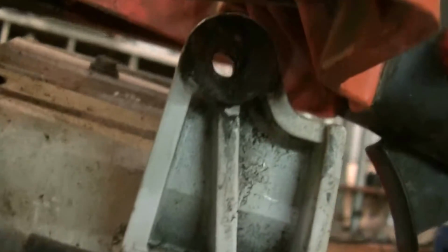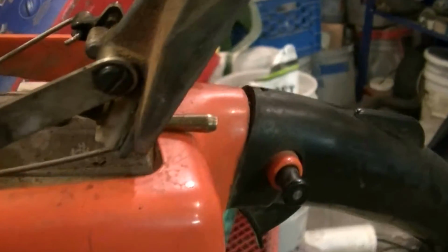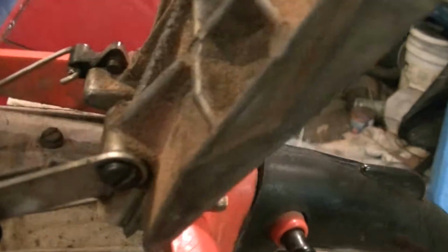T25 screws there. I don't know if you can see that little guy there. One up there. This one has a nut on the inside, that guy there. Oh, sorry about that. There we go. And so you need a 5/16 wrench, and that'll go. You'll have to hold and trap the little nut. I don't know if you can see my big finger here. It's pretty dark. So anyway, 5/16 wrench, T25 Torx to get in there, and there's this little brace on this air filter cover. That little guy has a slot in it there, and that bolt has to go through that.